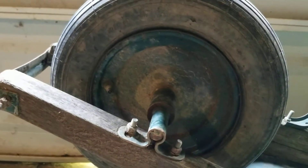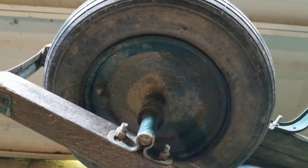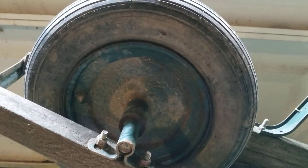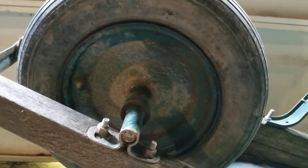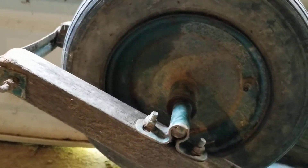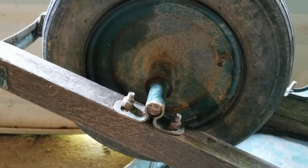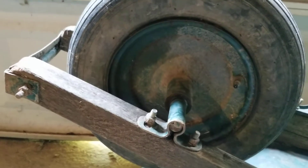That's the least dangerous way I've thought to do it. You can do it using lighter fluid or starting fluid, but with propane the reaction happens so quickly that there's little risk of it continuing to burn after that initial flame, and so it seats the tire perfectly. You either want to be quick to get your attachment hooked up to pump it full of air afterwards, or go ahead and have it attached already — and it'll work 100% of the time.